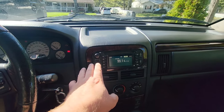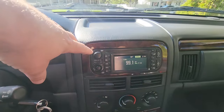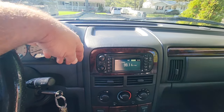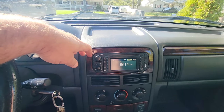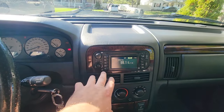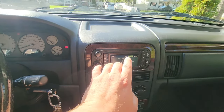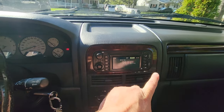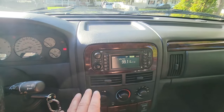The plug was used for a 10-disc changer and also for the nav. You could also use that input for a Sirius XM unit. So 2002, 2003, and 2004 WJs — you're going to need a head unit. If you don't have one, that's okay, you're just going to have to do a couple extra steps. I'll show you what you'll need to do if you want to convert your 99, 2000, and 2001 WJs over to a system like this. Let me show you the stuff you're going to need for this job.